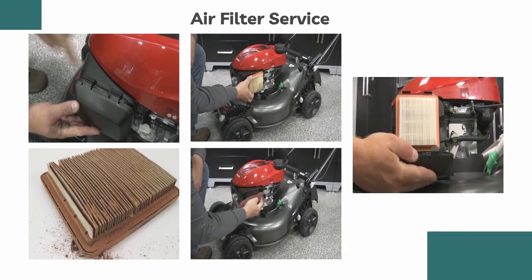The second step in maintaining the lawnmower is servicing the air filter. A clean air filter prevents debris from damaging your lawnmower's engine. Press down on the two cover tabs to remove the air filter cap. Tap the filter on a hard surface to remove loose dirt and debris. If the filter is in poor condition or very dirty, replace it with a genuine Honda air filter. Wipe any dirt from the filter housing before reinstalling the air filter, being careful not to introduce any dirt into the carburetor inlet. Firmly snap the air filter cover into place.